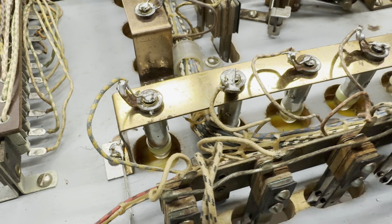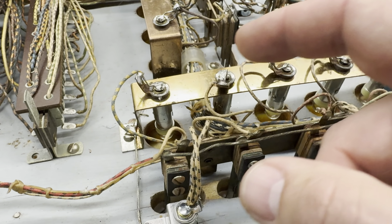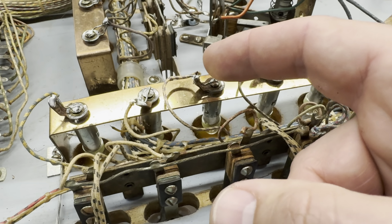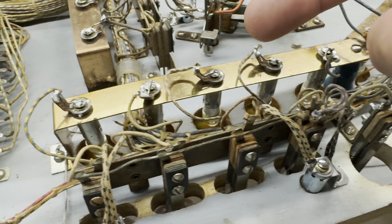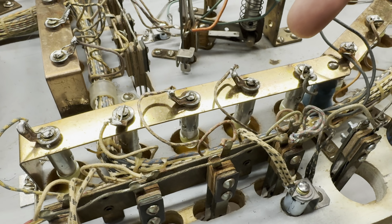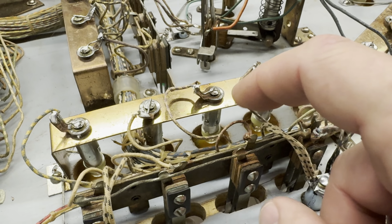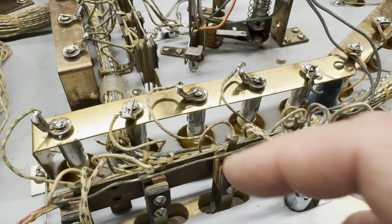It looks kind of ugly, but I've got that little jumper wire over the center post contact that goes up to where the wire is. And what you don't see is, if I flip it over, I've got solder that's flowed in from the base can up to this base metal, and that seems to help.